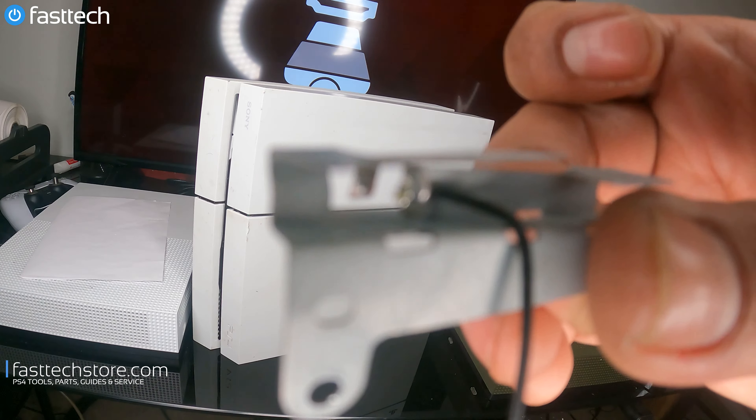As you can see, there's a soldering connection right here and that soldering connection is broken. There's a wire that normally runs through in between them, but that wire is broken and the solder needs to be reconnected. You can use a soldering iron to reconnect it, but you should make sure that these two solder points never meet.